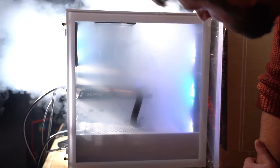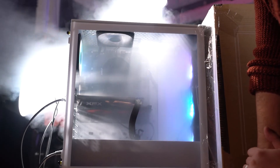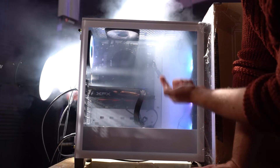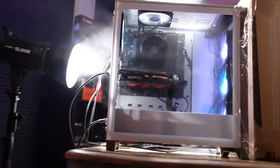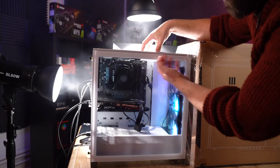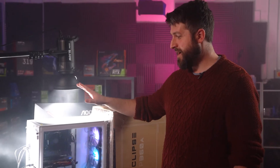The fog confirms the air temperature inside is relatively steady within a couple of degrees front to back, and slightly cooler at the rear where the hot components are. The GPU fans are being fed well, and air isn't escaping out the top as quickly — it's flowing through to feed both the rear exhaust and the CPU. With this case, two top fans caused intake air to exhaust immediately. The best use for the top slots would actually be a dual-fan AIO radiator.